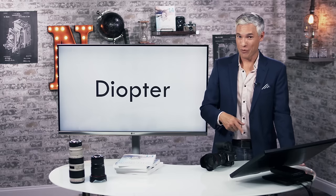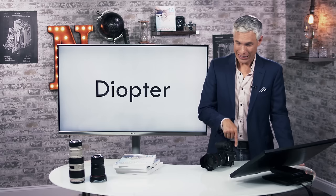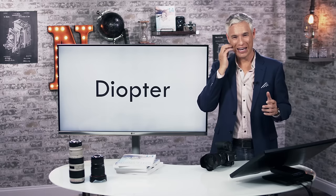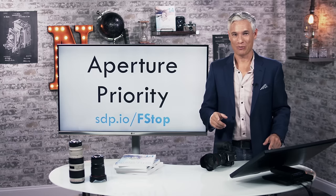If you pick up your camera and it seems like the camera won't focus or everything is blurry, check the diopter. It sometimes gets hit accidentally, but a lot of people think their camera's broken, like they can't get anything to focus anymore, and it's really just a little twist of the diopter.